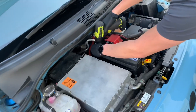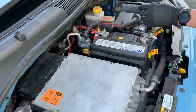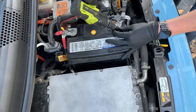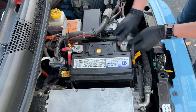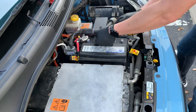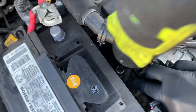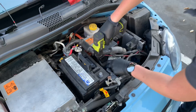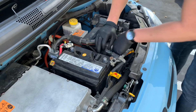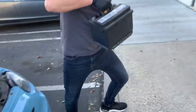So just familiarizing myself for a minute — this is your battery tie-down. Let's take this stuff out right here. Okay, let's see how heavy this thing is. There's something else holding this thing down. In here there's a bolt that clamps down the battery — you can kind of see it right here. It's a 13 millimeter, which is a little surprising. So I'm loosening that, and I think that's going to loosen up the battery clamp so we can move this out of the way. Whoa, this thing's heavy. Let's go inside and see what this weighs.